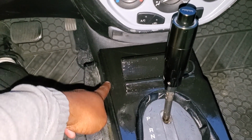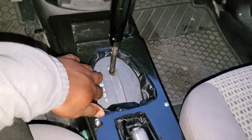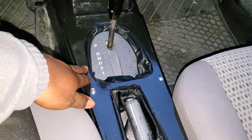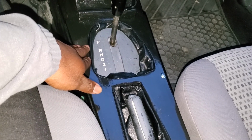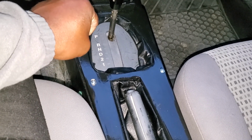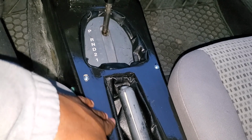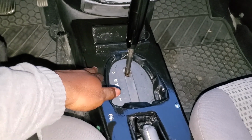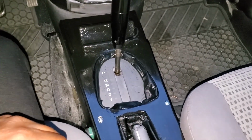It's where I routed the edges. So I have routed edges, but instead of vinyl wrapping it, I did do some vinyl, but I stapled it, as you saw on this part. And I also did a polyurethane finish. After coating it 3 times with paint, I coated it 3 times with the polyurethane to give it a little bit of protectant against water damage, splashes, abrasion, yada yada. And I really like the way it looks and feels. It feels really smooth. Yeah, I could have done a better job in some areas, like right here, but you'll be out here all day chasing perfection if you do it that way.